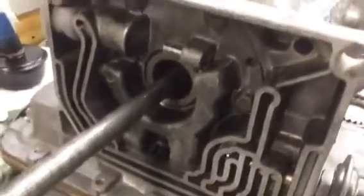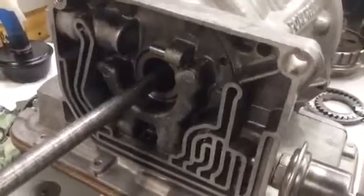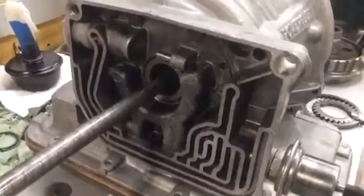That's basically just what the book says — it will destroy your transmission in short order. Now I'm going to show you how to determine which washers to install on there with the GM J tools.